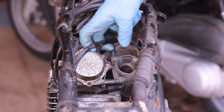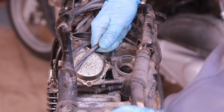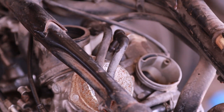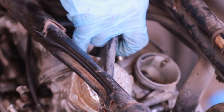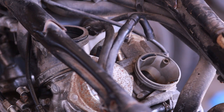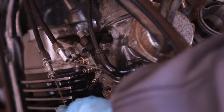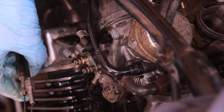We're going to have to remove this and there are actually two cables — it's a T. If I pull it up it's a T and it's very stiff. One goes into one carburetor, another one goes into the other carburetor. There we go — just by loosening it and then pulling it up. It is moving, so that's good. I don't want to damage it by prying it. The last thing I want to do is make more mistakes. I managed to remove one of the cables — this is the throttle one. If you roll the throttle this goes in and then this one returns it. Cables are out.